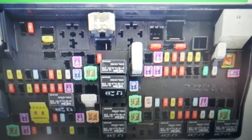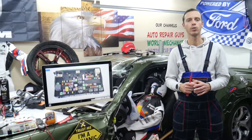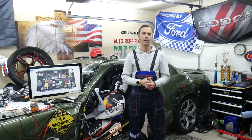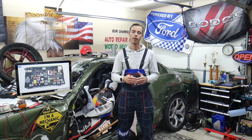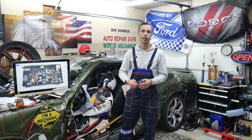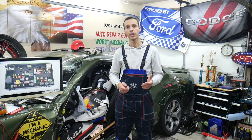The RF hub is the radio frequency module that detects and reads the key. It's a device usually located behind the back seat on the Dodge Ram, and it practically reads your key. If it fails, the truck may not even start or may not recognize the key at all. You'd need to buy a new one, program it, and make it work. We'll be making a video on how to program the RF hub module.